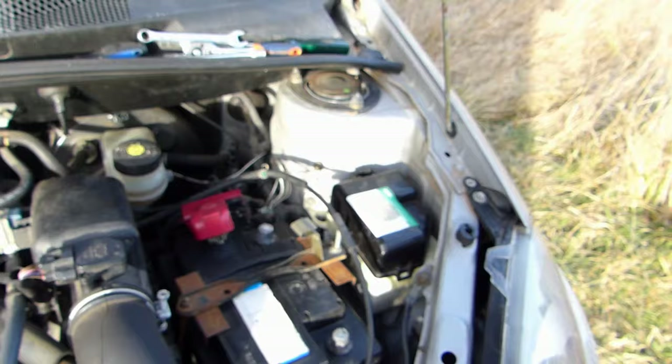Take off the battery first — it will be easier to open up that box because otherwise there won't be much space. With the battery removed, you have much more space to work. There are a couple of tabs you'll have to lift — one here and one there. I'm going to bring this one up with a flat head screwdriver, then you can open up the fuse box. There was a 120 amp fuse here and a couple of 60 amp ones there — this spot is a spare. If that grey part is melted, it won't make contact and your fuse is blown. You can open it up and unscrew it with a cross-head screwdriver or 10mm socket to change the fuse.